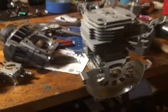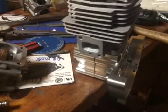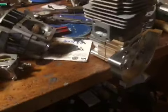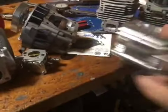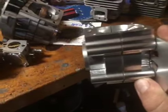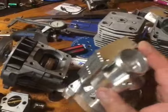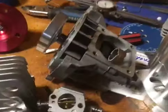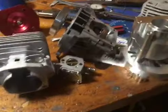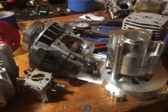I touched on this build a couple videos ago, doing a CY46 on my channel to fit into the Baja platform. This is a pretty badass case that you can bolt into a Baja. It's not like all the other 46s that have the 78 millimeter clutch for the scooters. So that's a build that I'm doing. I got a plus one crank for it. I'm gonna do that full ported, with a big Sloan reed or Schlitz, however you say that, a cylinder reed for it.